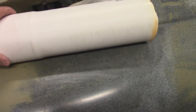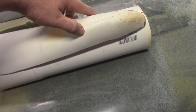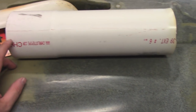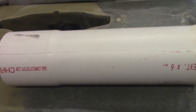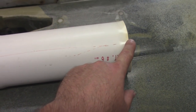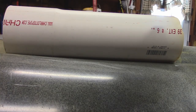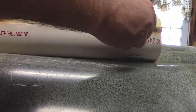Here's the piece of pipe I cut — roughly the same length as the finished one, somewhere around the 12 or 13 inch mark. You're going to have to do a lot of cutting on this anyway. What I'll do next is take the torch and heat up just where the line is, then take my razor blade and cut a slit right down it. You don't really need to be perfect with this because you're going to shave a lot of this off anyway.